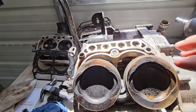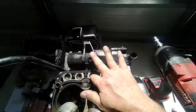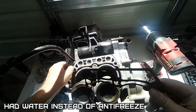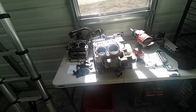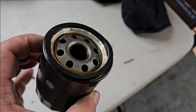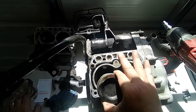Wrist pins weren't bad at all — no play. But these connecting rods don't unbolt, so basically it's not going to be fixed, because they want a thousand dollars for that complete rotating assembly. There are your hydraulic lifters and base gasket. Someone put water in the system like an idiot. It still has a chamfer on the rings — I think someone tried rebuilding the top end on this. That's what happens when you don't maintain these things and let it run low on oil. The reason it ran out of oil is that somebody put this on and the gasket wasn't pushed on right, so it was leaking — that's what I saw when I first bought it and it was idling. It's probably worth keeping an eye out for a connecting rod from someone who tears one of these apart.